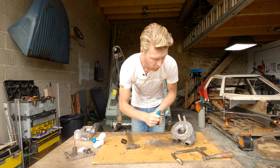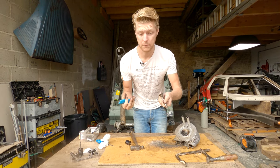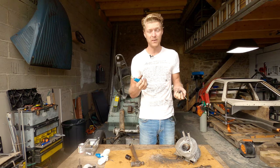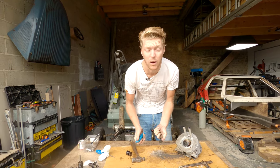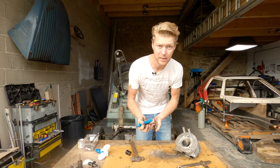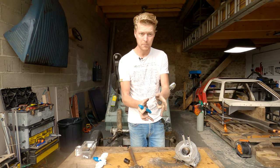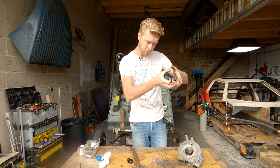And because there's no way this exhaust valve was sealing like this, when your piston comes up to do your compression stroke, it's just running out of the exhaust valve because it's not even a sealed container. Because that's what an engine is, after all. An engine's an air pump, so it needs to be able to breathe. And it's a fast burn. It's not an explosion, but it's a fast burn in a sealed container. And the fact that it's sealed is what forces the piston back.